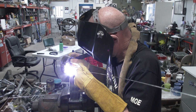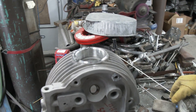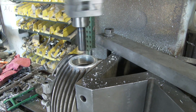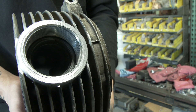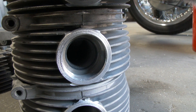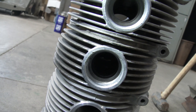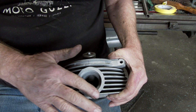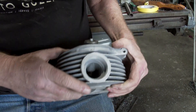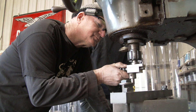When we're done, after the weld is done, we're going to machine it off. When it's done it's going to look like this - this is all before it gets rebuilt by the head guy. The weld gets shaved off. We have to leave about a millimeter on top so it has some strength, then it gets chamfered and faced to make it look pretty. You can see what's left of the bead, and it's a much stronger thread. We don't have any problems with these stripping out anymore - it's probably twice as strong as the cast aluminum threads.